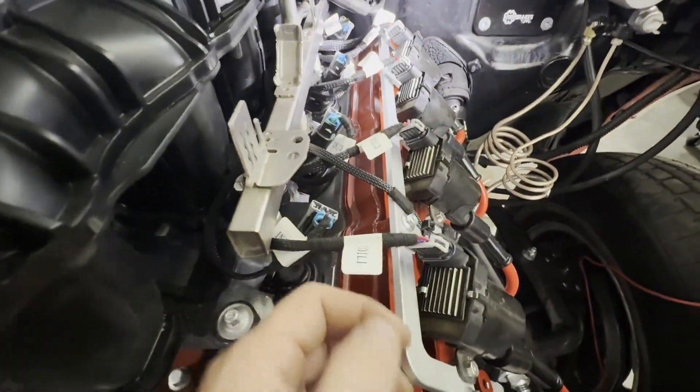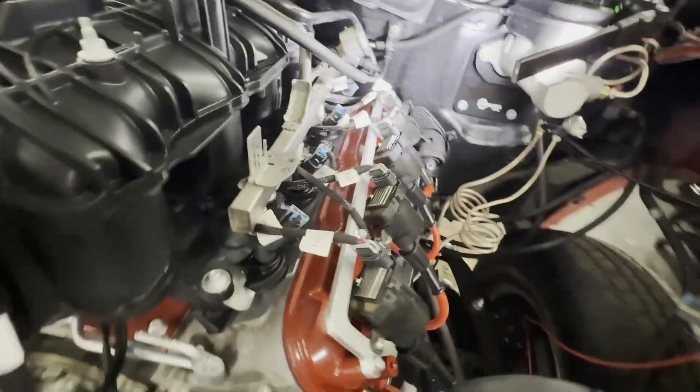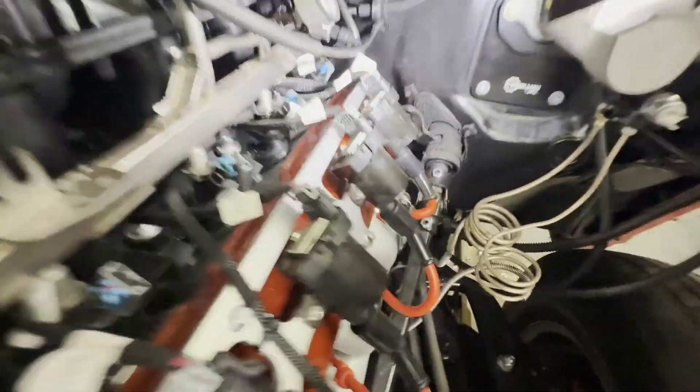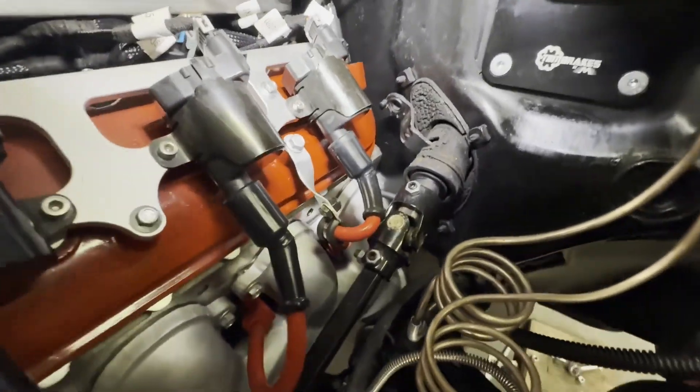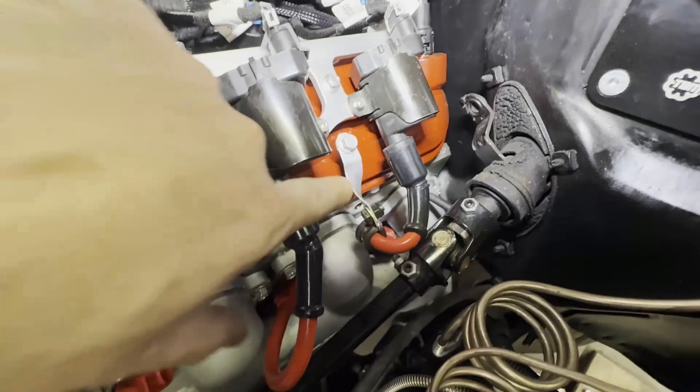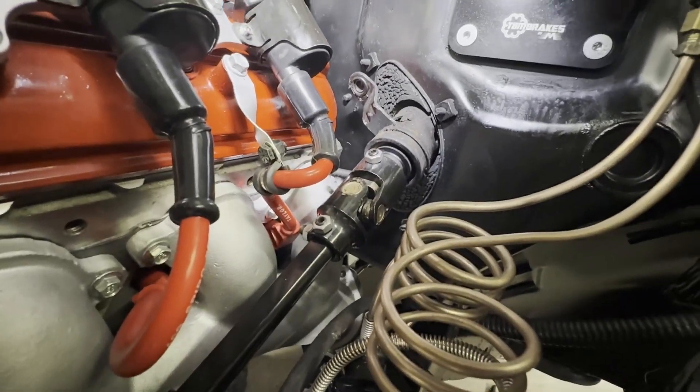I did leave all my tags on here until I get it running — I don't want to miss anything, cut all the labels off, and then cause myself a headache later. These coil wires are the Taylor 10.4-millimeter 409 series, and they are the 45-degree boot. All of them fit very, very well. They clear around everything except for that one right there. If you didn't see my last video, I made a bracket basically out of a piece of steel, bolted it to the valve cover, and twisted it with a cushion clamp and a quarter-twenty bolt with a nylock nut so it doesn't come loose. It's got all kinds of clearance around my steering shaft.